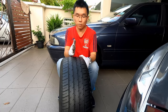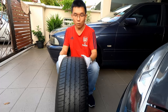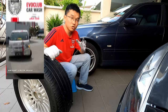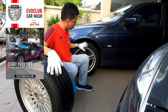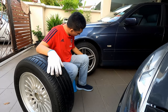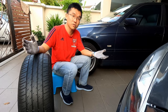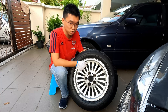As the face moves closer to the outer edge, when mounted the wheel gradually sinks into the body of the car. Choosing the correct offset is extremely important: too far out and the tires will rub against the fender; too far in and the spokes will interfere with the brakes, and the inner part of the wheels and tires will interfere with suspension components.